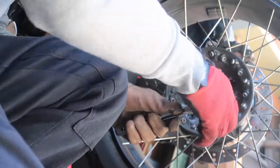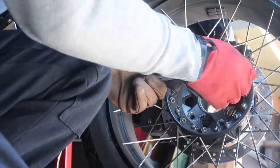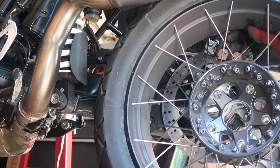You'll find that as you work on your bike, ease of maintenance is built into the design. For instance, to remove the rear wheel, all you need to do is unbolt the five wheel bolts — you don't need to deflate the tires or remove the mufflers, with the exception of the 90 Classic. Go slow and easy so that you don't slam any metal together.